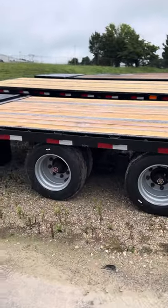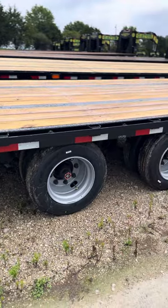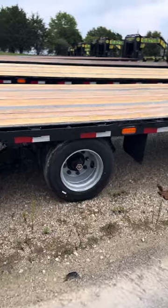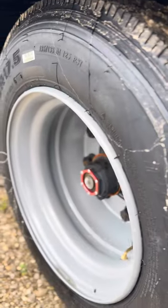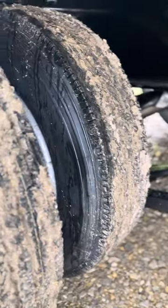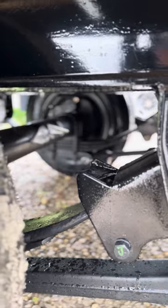The biggest feature on this trailer is the axle upgrade. These are Dexter 16,000 pound disc brake axles — they're electric over hydraulic. You can see your tire pressure there. These come standard with a set of 17 and a half inch rims and 16 ply tires, and they will come on this HDSS suspension. You can see underneath there — you can see that disc.